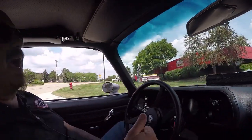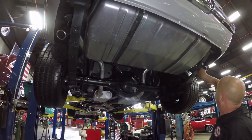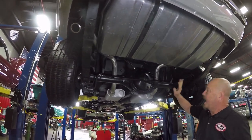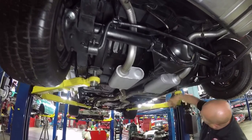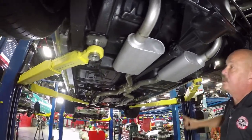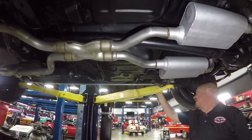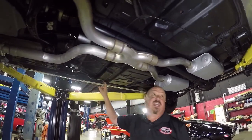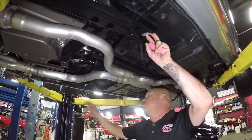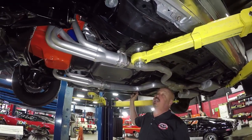We're going to put this car up on the rack so you can check out the underside, then we're going to pop the hood and take a look at the power under the hood. All right, we're underneath this '73 Camaro now and she's just as pretty underneath. Brand new tank, dropdowns look good, brand new exhaust system. 10-bolt rear end — there is a posi in there and it's running around a 3.42 gear. Exhaust looks good, looks like incinerator mufflers but they look just like Flowmasters. I always check the pinch weld where the inner wheelhouse goes to the quarter — that looks nice. The pinch weld where the floorboard goes to the rocker — that looks beautiful. The fuel line looks like it's new going front to back. Brake lines are in good shape.